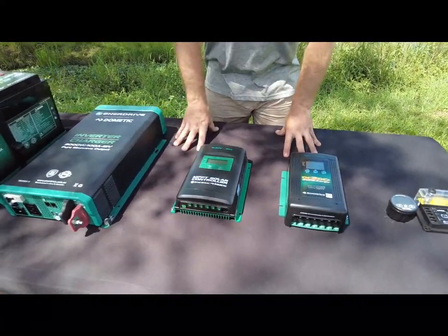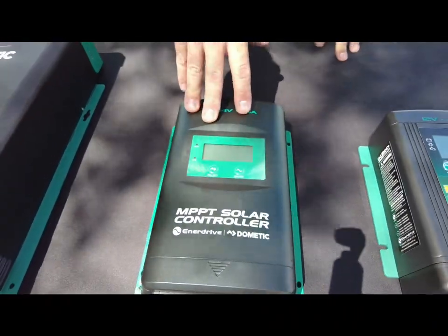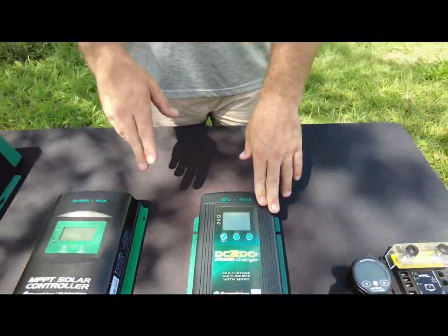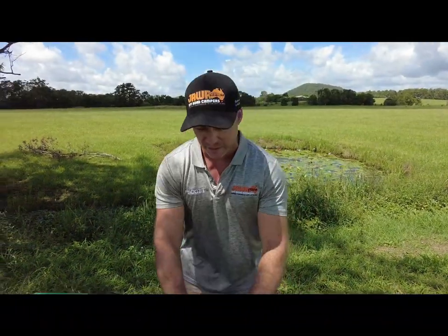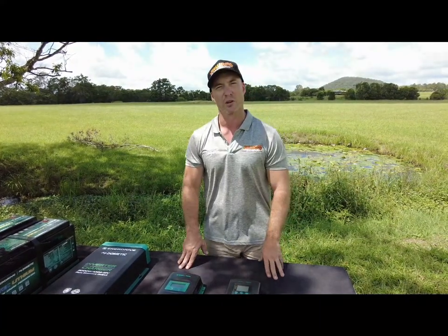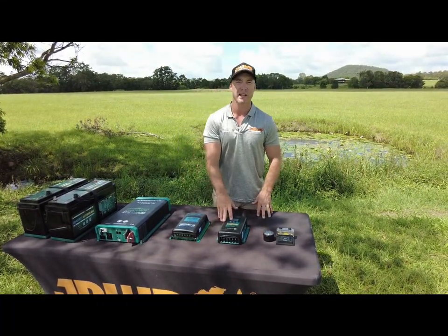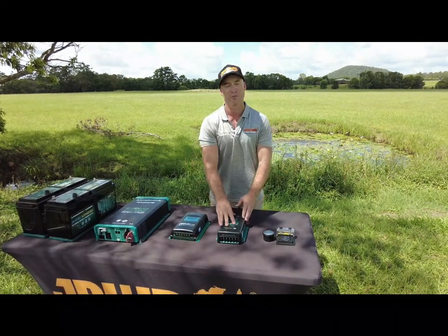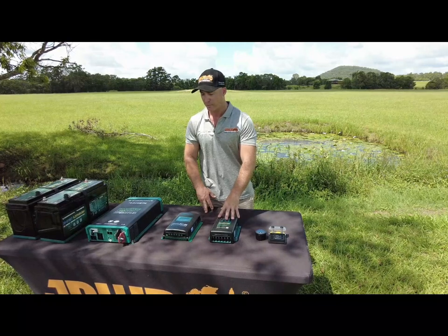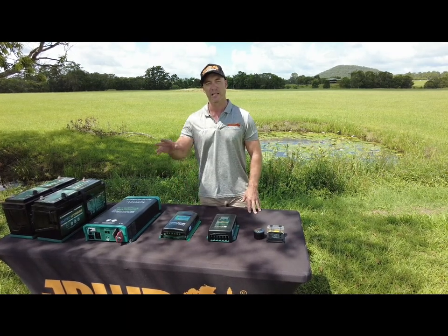Moving on, there is 600 watts of solar on the roof, and that's looked after by the MPPT solar controller — so all 600 watts regulates in that. We've added a DC to DC here so that you can utilise portable solar panels into the Anderson plug and plug another 600 watts, giving you 600 watts from the roof and 600 watts plugged into the external Anderson plug — a total of 1200 watts. The MPPT looking after the roof solar will still take care of it when you plug into your car, while the DC-DC takes care of the car input — up to a max of 40 amps at a time. On a perfect day, we're probably looking around 29-30 amps coming in from that 600 watts.